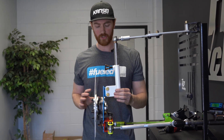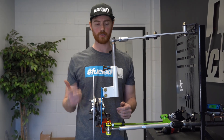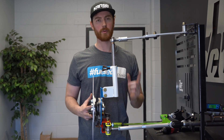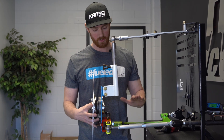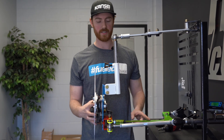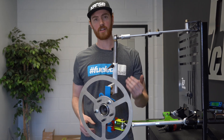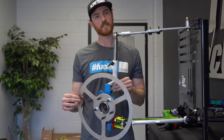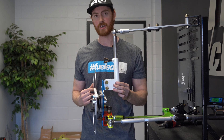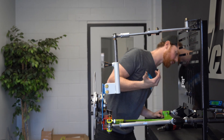For yourself you're going to be able to decide, when you're buying a kit and understanding what's happening with it, what you're going to end up with at full lock. This is the prime example of you and your buddy having the same caster, camber, and toe settings but the two cars handling differently — maybe John got his camber from the lower control arm and Steve got his camber from the knuckle. They're going to have a different angle at full lock and a different contact patch, and the car is actually going to behave quite differently because of this KPI angle.